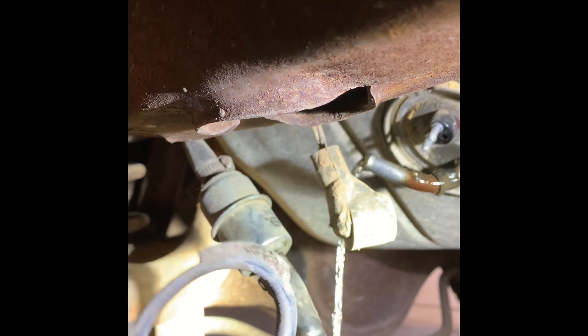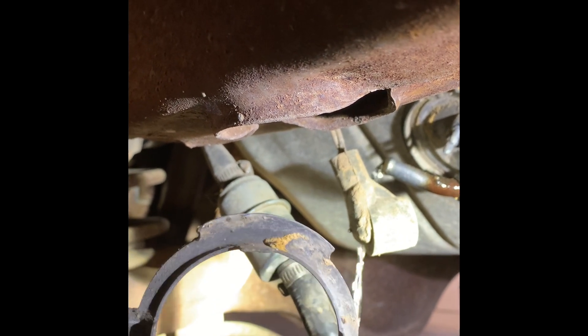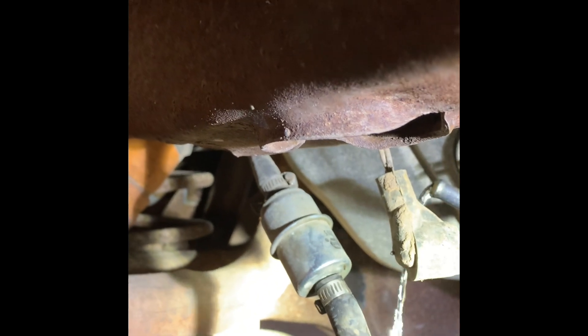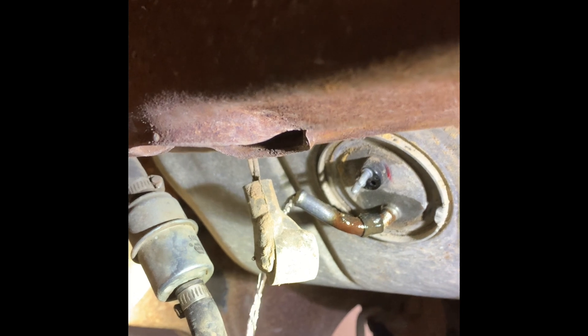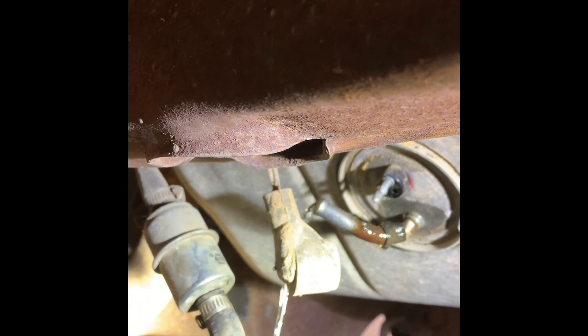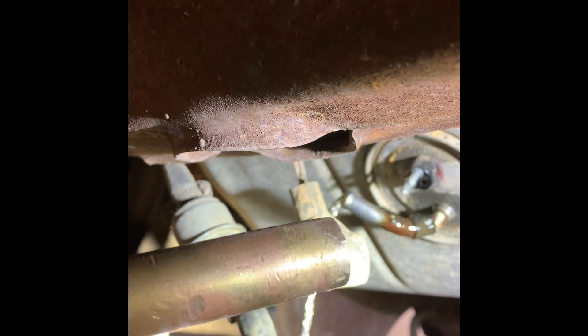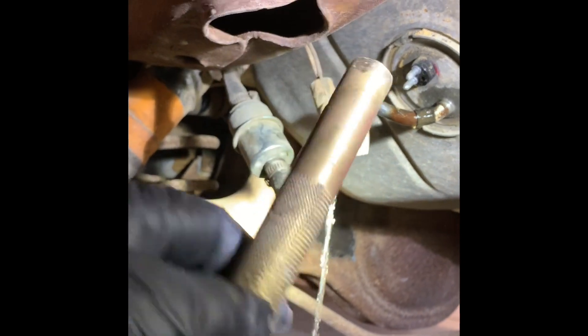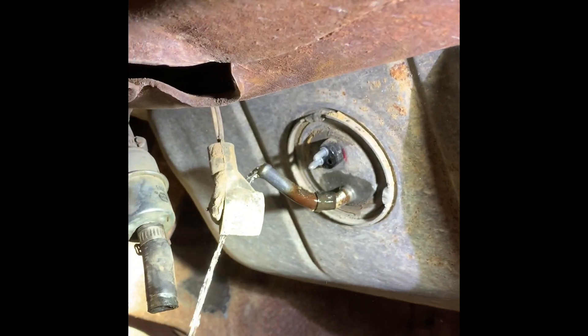To get this guy off you need a special tool, or a different special tool. Personally I have the tool for pickup trucks and newer model vehicles, and it did not fit on this one. This is just a brass drift. You're definitely going to want to use a brass hammer and a brass drift, just to try to keep the sparks to a minimum when you're working on a fuel system.